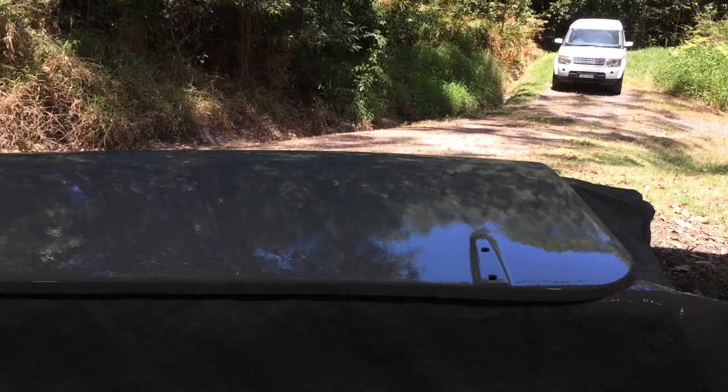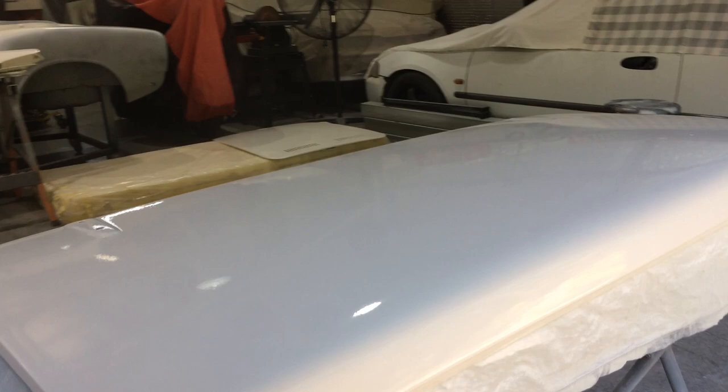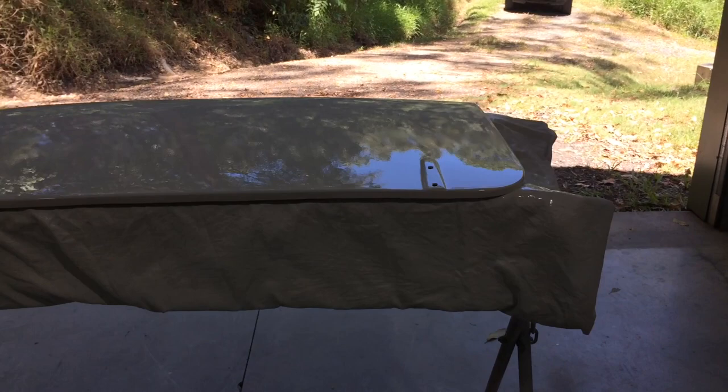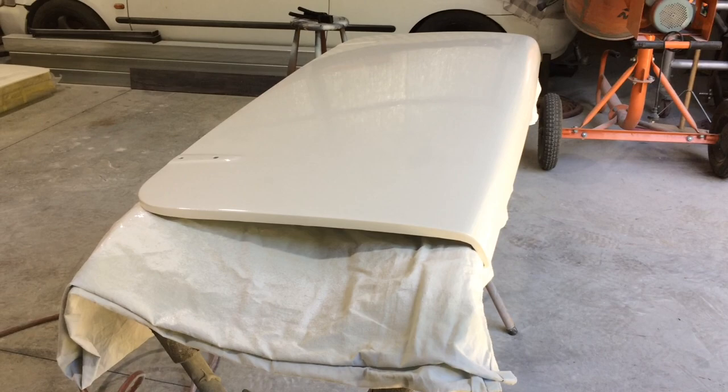That's the third coat. I'll give it one more, that's it. That's all you need. You don't want too much paint on stuff. It's not really good for it. Now you want just enough. That's fourth coat, that's plenty. I'll cut that with 2,000, maybe, and then 3,000, whatever, at least two, and just buff it. Give it a nice buff, it'll look terrific.